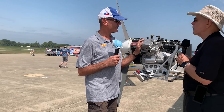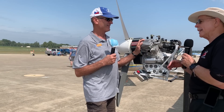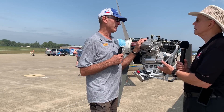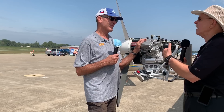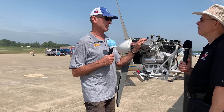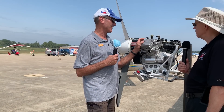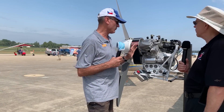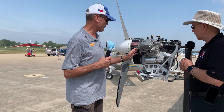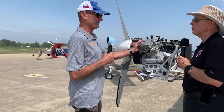The power is 60 horsepower, four-stroke. Because it's a four-stroke, operating RPM comes down to about 5,000, kind of like a Rotax in that sense. The whole power range is smooth — you have to find that smooth spot. I always liked that about the HKS and I like it even more about this. It's also water-cooled, so you don't have fins and air-cooling issues.